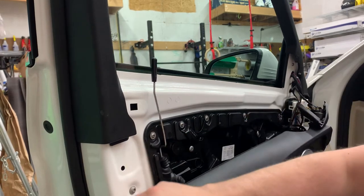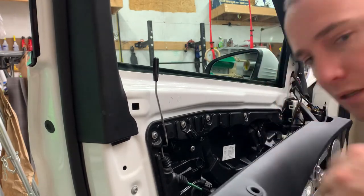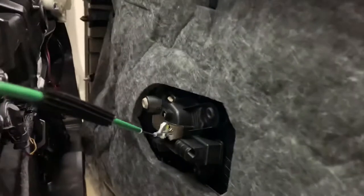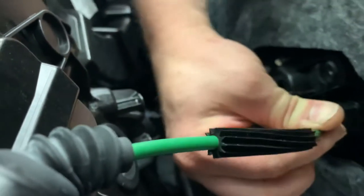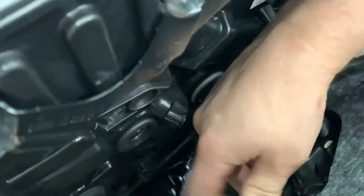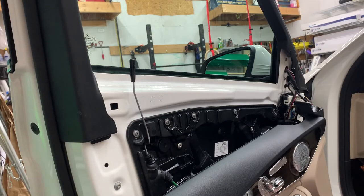So the back side of the door — right there — it slides up and in. You'll hear it snap like you heard. So we can feel it. And another thing is, like I was saying for the back door, Mercedes-Benz uses a hook loop system for their door handles. Just make sure before you put it back on, you pull it back and slide it over top of that. So you want to line it back up and put the green back inside that tube. If you don't, the door handle is not going to work. And as you just heard that little pop noise, it was popping back out — so the moment you let it, just tighten it, it will pop on like that.